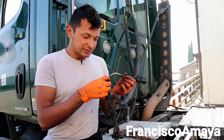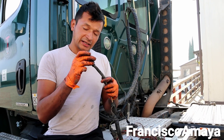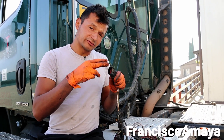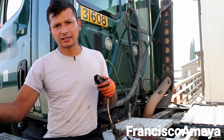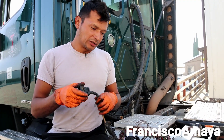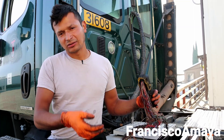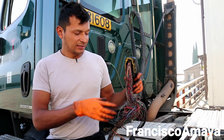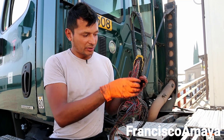This is why you have to investigate carefully. Sometimes the problem can come from wiring going to the cab or to the emissions computer, not the main engine harness. You could replace the main harness and the problem still exists. That's why it's important to check all wiring paths before committing to a repair.